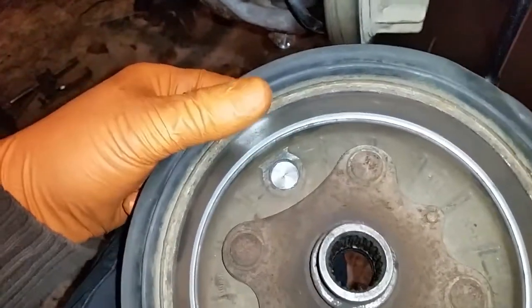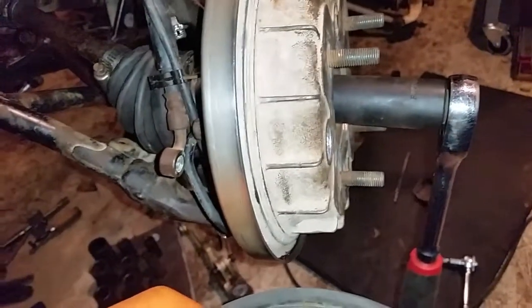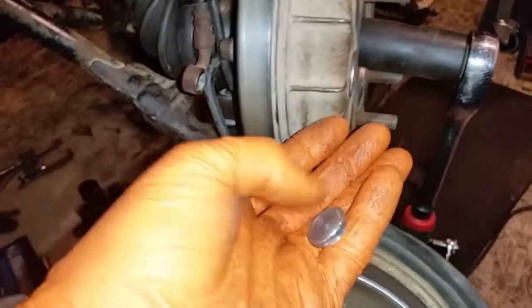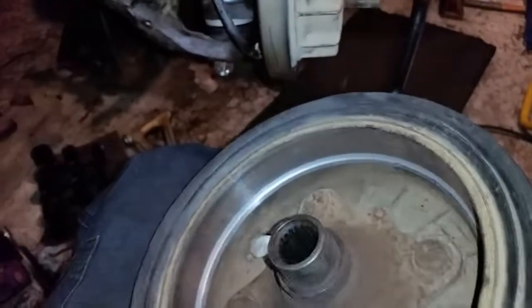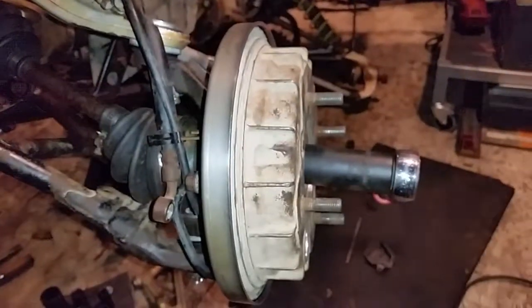I think that's why my front brakes got completely destroyed — they're full of dirt and mud and rust because these plugs must be missing. I don't actually know what goes here; I never really found anything online either. But I asked him to make me these plugs and we should be good there. One other thing I did is I lightly greased this dust boot that's all around here, so that it has a nice easy contact surface but will also sort of keep the dust out as well.